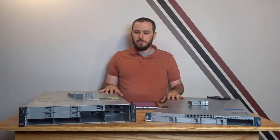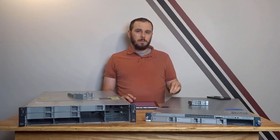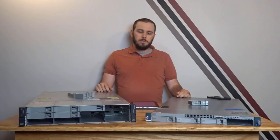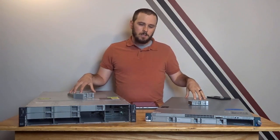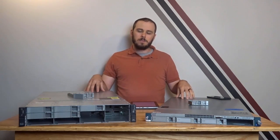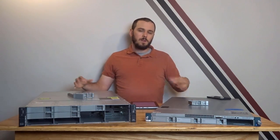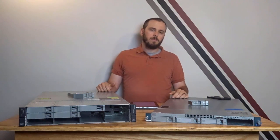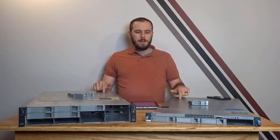The stuff you can do with UCS is really cool. I had a server that absolutely refused to POST and I was able to remotely clear the CMOS, remotely flash the BIOS, and get that server back up and running without ever having to leave my desk — that's really powerful. Cisco has built a server system that is that easily remotely managed. Adding servers is also incredibly fast with the profiles in UCS Manager — you can bring a server in, put it in your environment, apply a profile, and be installing an OS ready to go in 15 or 20 minutes. That's maybe not quite the homelab fiddling spirit, but if you just want to replace a server and get it up fast, this is the way to go.